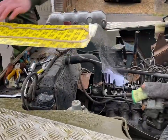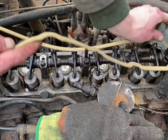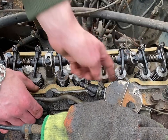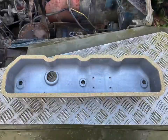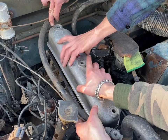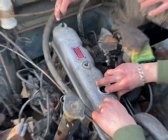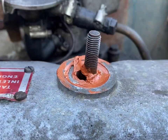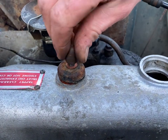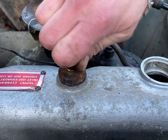Here I've got a brand new gasket — just trying it for size. I'm happy with the gasket's fit; I've attached it to the bottom of the rocker cover to make it easier to align to the vehicle. Here I'm just applying some engine instant gasket, just at the top of the rocker cover around the rubber grommet. The rubbers are not in the best condition, but I plan to set the tappets on this engine at a later date if it all runs okay, so I will be back in here again.